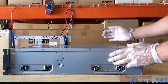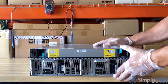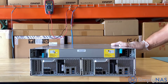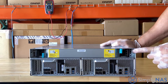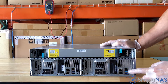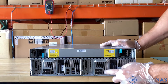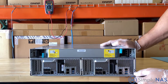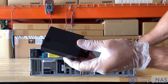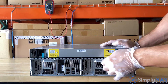Let's take a look at the back. You'll notice that there are two of each — this is a dual controller system. Starting from the top right: this is our power supply. Below that is our ethernet connection — there are three of them. Below that are two USB 3 connections. Next is the battery, and next to that are four 10-gigabit ethernet SFP Plus ports. This is your battery backup unit, or BBU. If a sudden power loss occurs, the BBU enables write cache data protection, and at the same time the data is replicated to a backup controller to achieve 100% data integrity.